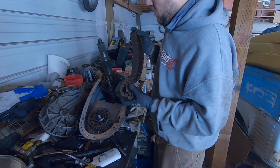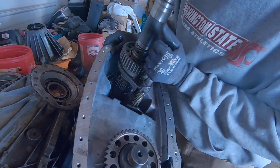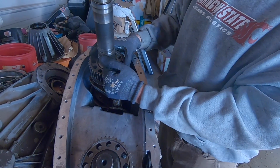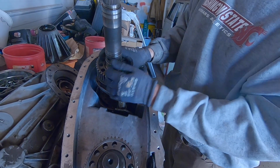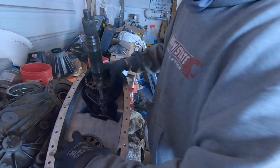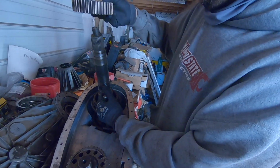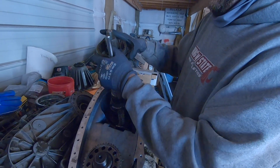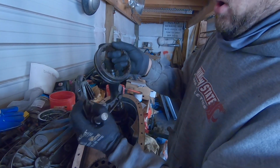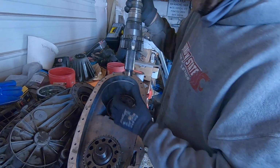So, what you end up doing is pulling your chain off. Your shift linkage pulls in to engage. So two-wheel drive, it'll engage into four-wheel drive, which will then lock this sprocket up, which will drive the chain to drive this sprocket, which is your output for your front. So to change the input shaft, you have to pull this off, pull the shift linkage off. Be careful, this can fall out of the holder, and there are these plastic retainers, guides, and then this shaft lifts out.